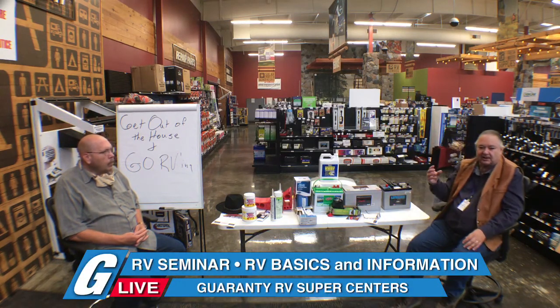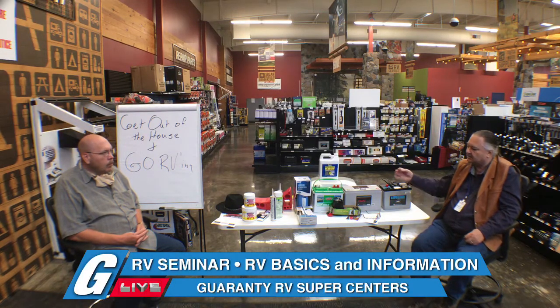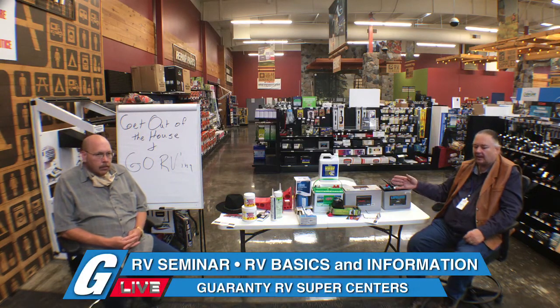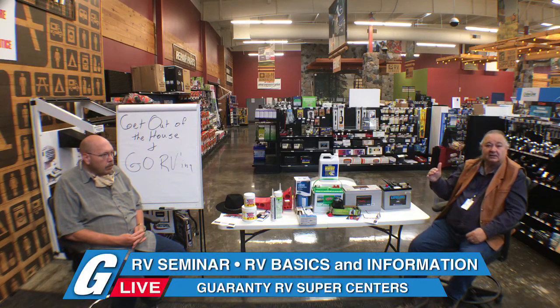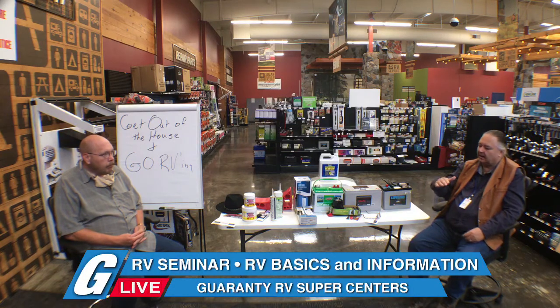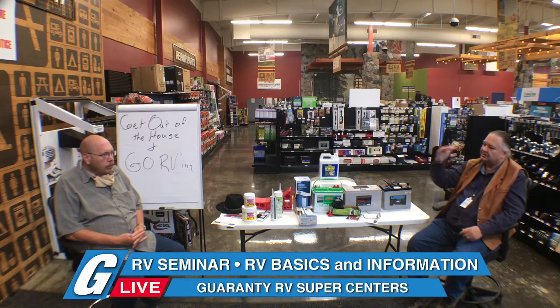If you try to take any more power out of it — say you're down to 10 volts — the lights won't work and the furnace won't come on because there's no energy left in that battery. That battery has to be maintained at least 12 volts. A lot of times you plug in and it jumps right back up to 12.5 or 13, then 20 minutes later it drops right back down again. That's a surface charge.